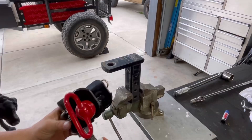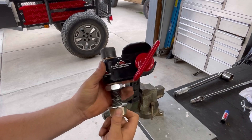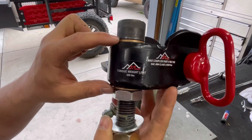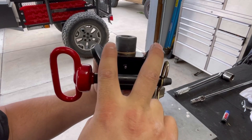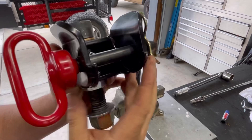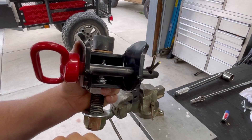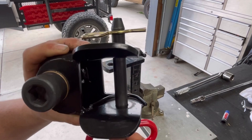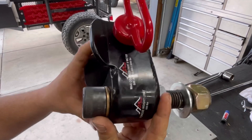Here's your receiving side of the Max Coupler. If you're going to order this, it's going to be part number MC-169. Here's the stack-up — this is what it's going to look like. You have two thrust washers between a frame, and that framework is what I call the bucket, and basically the bushing of the other end of the tongue just seats right in here. It has some really nice seats for that bushing to set in and it's an exact fit. As soon as it seats right in, the pin slips right in. That's the stack-up — a thrust washer on the top and on the bottom, and then a jam nut.